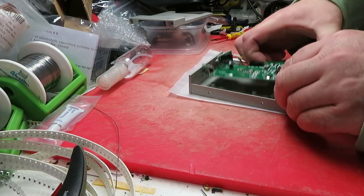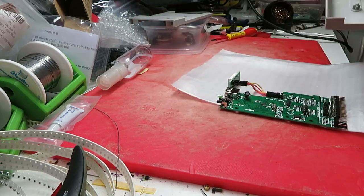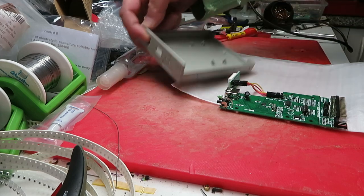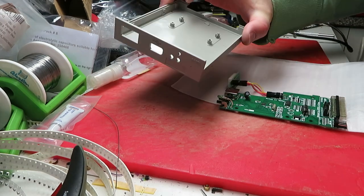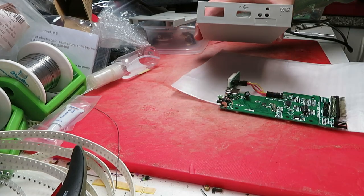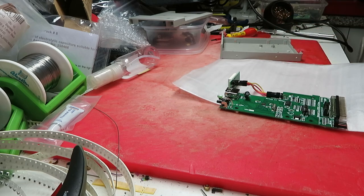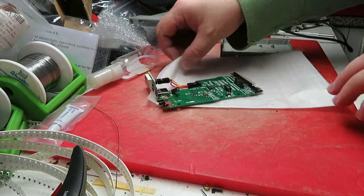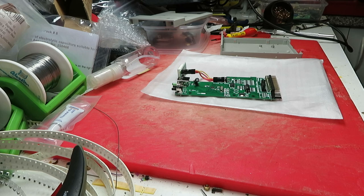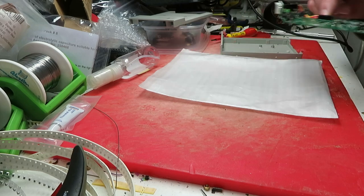What I'm printing at the moment is a replacement case. I didn't design this bit - someone else did. I got it off Thingiverse. You take potluck when you get them from China. It's already got the OLED strip in it and a space ready for the rotary encoder. Looking at Flash Floppy's website, which is the firmware we're going to use - I've done a lot with GoTeks in the past but they've always been for Amigas and Atari STs.